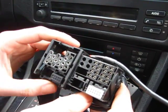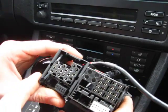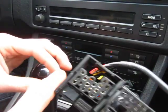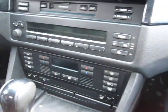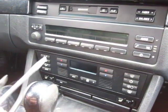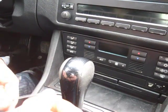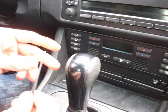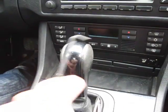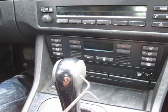You have to see which kind your car is using and make sure you don't have DSP as an option in your car stereo, because this kit will not work if you have DSP. Now we'll go over what tools you need: a flathead screwdriver, a Phillips screwdriver, a 2mm Allen key, a 2.5mm Allen key, and a magnet is also suggested because the bolts like to fall down.